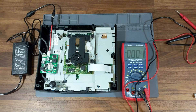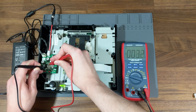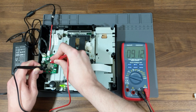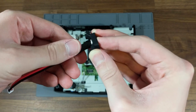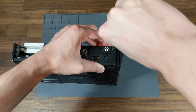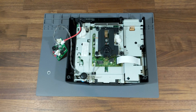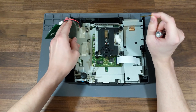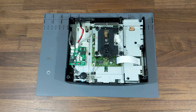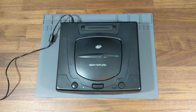The installation was complete, so I pressed the power button with no hesitation, and the Saturn came to life. While the Saturn was powered on again, I tested the voltage output on the ReSaturn's main header to verify it was still providing the correct voltages under a basic load, and again the ReSaturn passed with flying colors. To finish the installation, I attached the power input jack to the included backplate by unscrewing the washer and nut from it, then placing the nut on the side of the backplate facing the back of the Saturn and screwing the jack in from the other side. At this point, I realized I had forgotten to install the small piece of clear plastic that sits below the Saturn PSU during my post-cleaning reassembly, so I quickly took the ReSaturn PSU out, installed the plastic, re-seated the ReSaturn, and then neatly routed the cables. With installation and assembly fully complete, I put the top half of the Saturn's casing back on and plugged the power supply in for one last test before screwing everything back together.